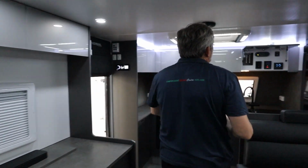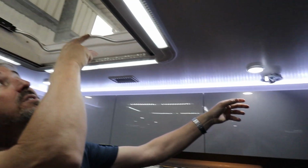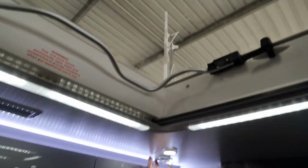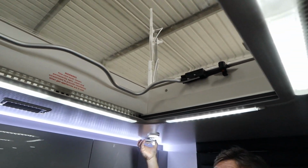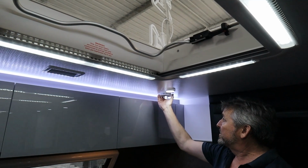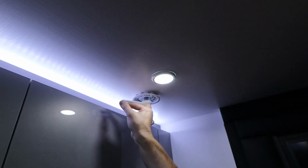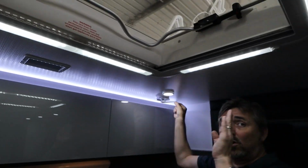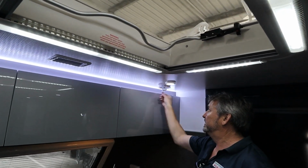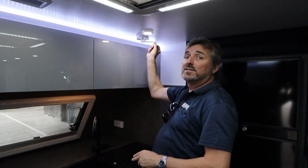Now, if you're not getting a good picture, back up here above your master box is your digital antenna, which is that one up through the roof there. Once you've wound it up, you can pull the collar down and spin it around to get a better picture. When it's time to pack it up though, line up these two peaks and then wind it down. Because what it's doing now is it's going to wind down and sit in a nice little cradle on the roof, so it's out of the way. If it's down, it's done.